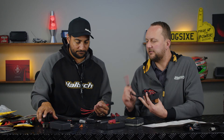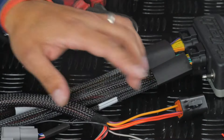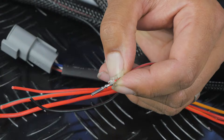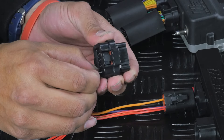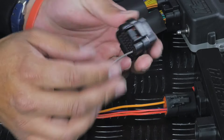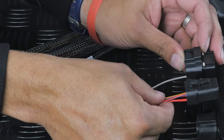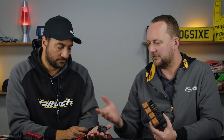This is not going to be a DTP pin — we're going to use the ECU-style pins that come in the kit with the ECU connector, and we'll look in the wiring diagram for the CAN power pin. We're putting that into pin 25, which is the CAN power — make sure the pin reaches the end of the connector, meaning it's fully inserted. Now to recap what we've done: we had four relays and four fuses — four circuits — and we've split them into four circuits here. The remaining wires were the power supplies feeding them, but the PDM gets its power supply differently — from the battery positive post on top.